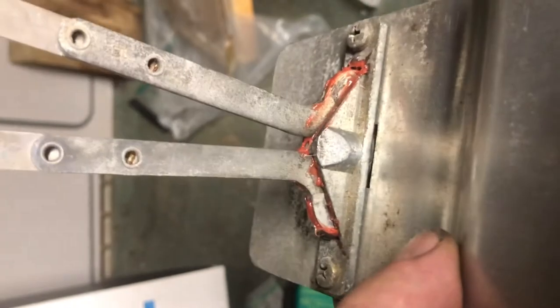We don't have this cinched down yet, but this fit is not good. It's hitting a flat gasket and that gasket is nowhere near big enough — it's basically not even getting inside. I'll tighten all this stuff up and we'll see if it gets better, but that fit is bad. Put a little grease on there. Everything is tightened up and adjusted and I still think this thing fits like crap — it's bowed, there's a big gap even though we're tight in other spots. I could stick my finger under there. That seal is not sealing from about here to about there, same thing on both sides.